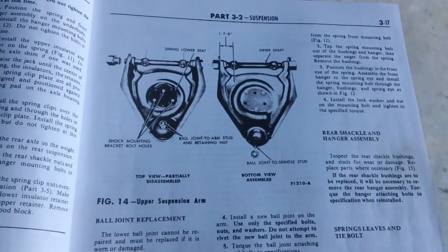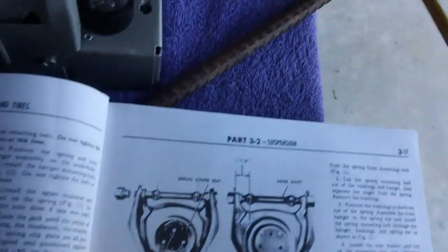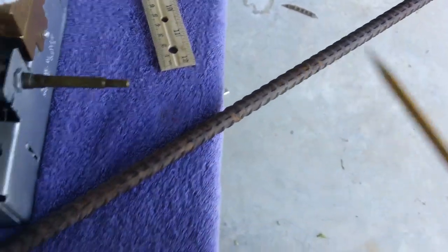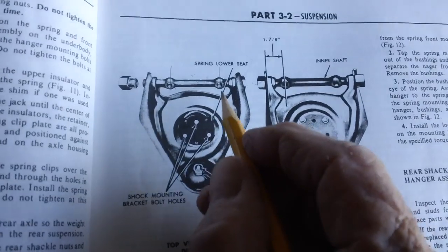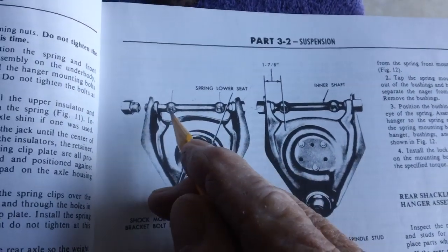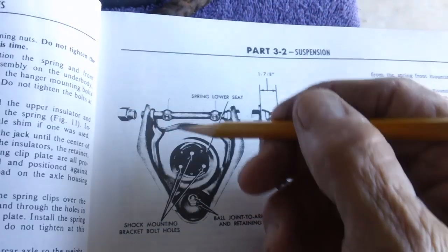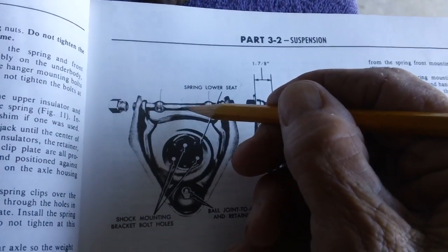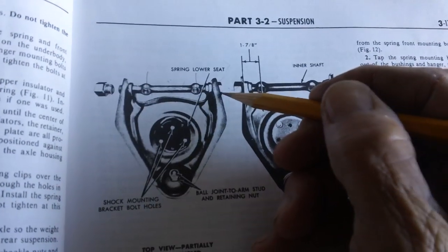They want you to use a pipe — a one-inch pipe or a three-quarter-inch pipe. I'm going to use rebar. I've got a nice stiff rebar. We're going to take my cutting tool and cut off nine and a quarter inches, jam it down between here and here parallel to this horizontal rod. Then we're going to take the whole thing down, put this rod in the vise, and start torquing these bushings on.